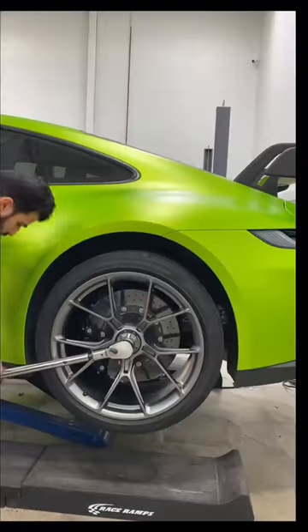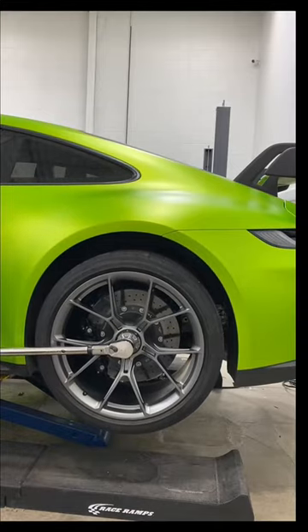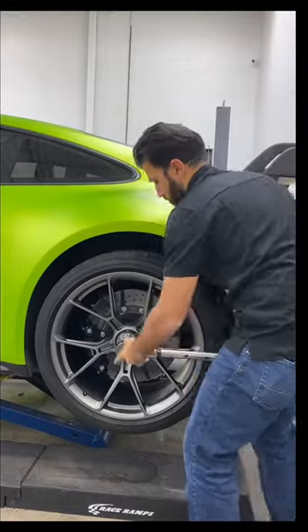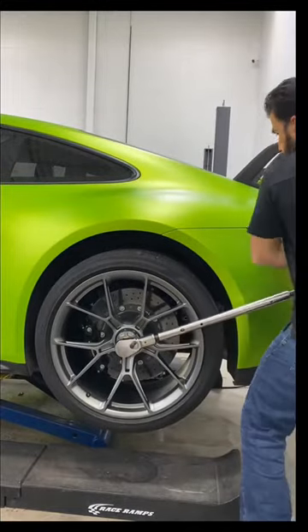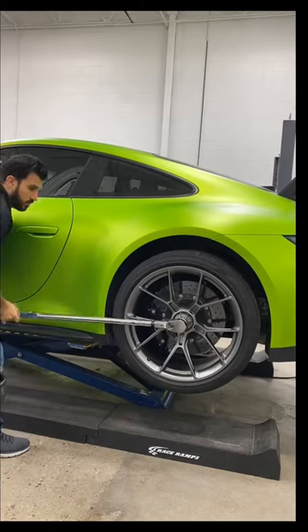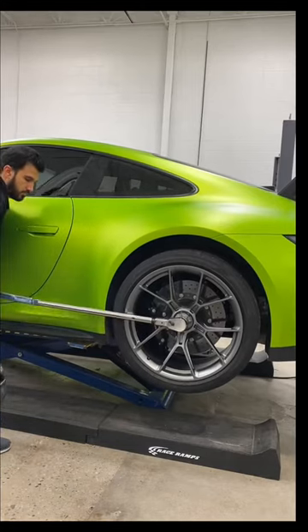Once all that's set and done, now let's put the wheel on. I go ahead and transfer the wheel to the hub, put the center lock in and give it a torque — 444 foot pound. I torque it down the first time and then loosen it back up by 90 degrees, and then torque it one more time. Unwritten rule: I always torque it twice. It's not useful and it's also not harmful.